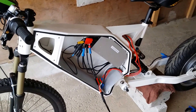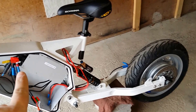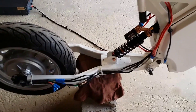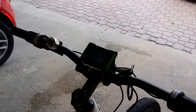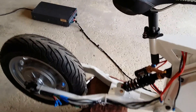I'm going to try to get the second controller in today. I have pretty much everything to wire it, except I didn't finish up the hall sensor adapter from there to down there, because I wasn't sure if the combination would work first go — and it did. I've got to figure out all the custom settings to get the two-wheel drive to work properly with a single motor that's dual winding and these two controllers.